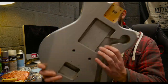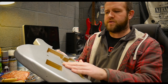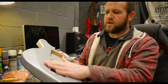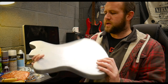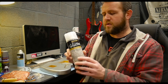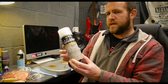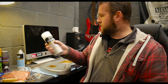It's smooth, there are no runs on it, and it does have a nice sparkle to it. But if you want a super smooth finish, go over it with wet and dry at the end — just make sure the paint's fully dried — 1500, 2000 grit, then once it's smoothed off, clean it all up, get some car cutting compound and give it a really good buff to bring that shine back. With spray paints, to get a really good finish make sure you've got the right room temperature — it'll tell you the recommended temperatures on the can. Just make sure you're doing it in a well-ventilated warm room, and if the paint's cold stick it in a warm bowl of water to get that paint nice and warm.